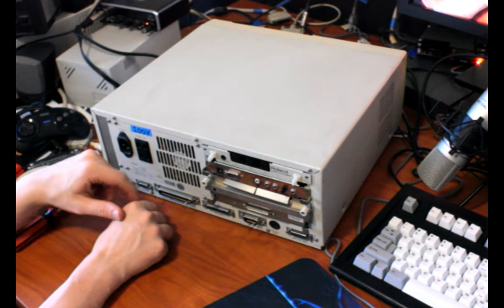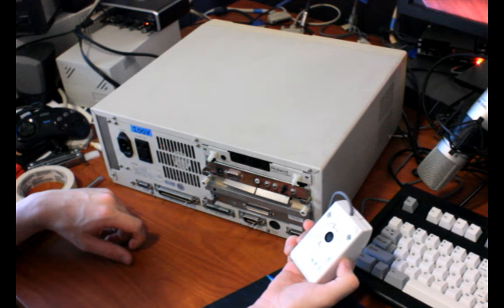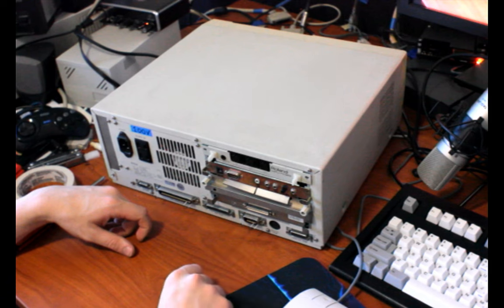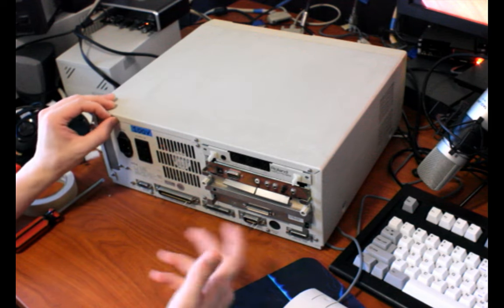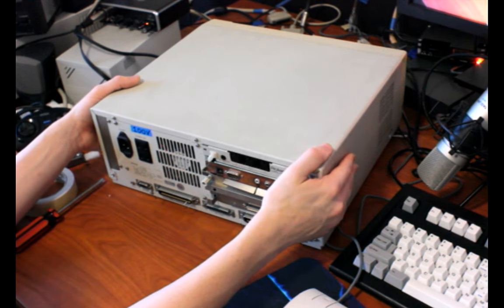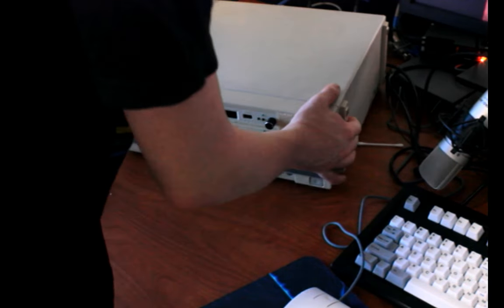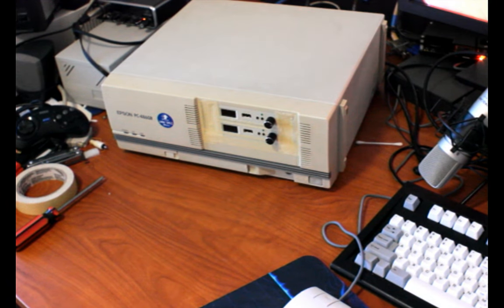There are adapters to let you use mini DIN bus mouses, which is actually what I'm doing. This is a Logitech PC-93-MD mouse. And yeah, so this is on a 9-pin D sub from a later PC style bus mouse from before PS2 mouses really took off. You can also modify the pinout on other quadrature mouses like Amiga mouses or Atari ST mouses, I think. Maybe even Apple ones, pre-ADB Apple ones. You'll see a lot of ADB stuff if you're searching for bus mouse online, so that's not the same. So don't let it fool you. Even though it's called Apple Desktop Bus, it is not the same bus. The bus mouse is probably talking about the internal card bus interface.